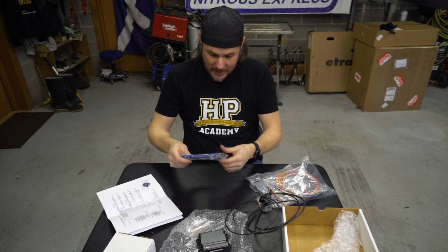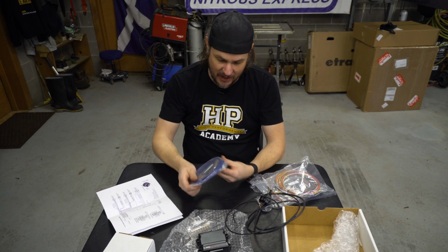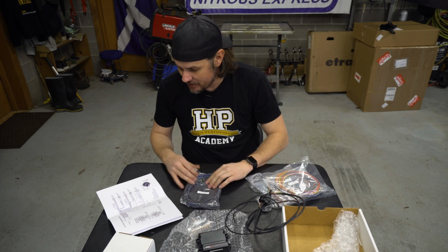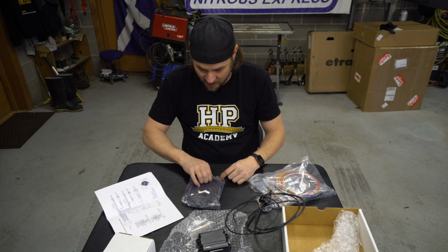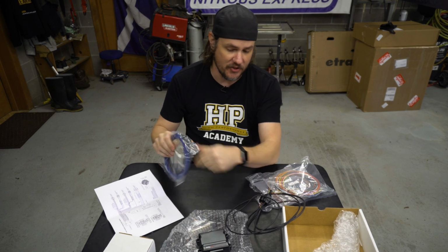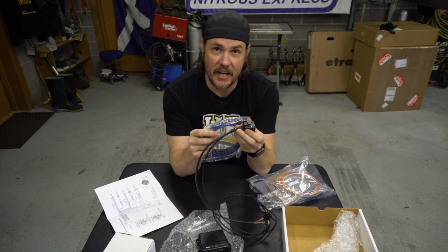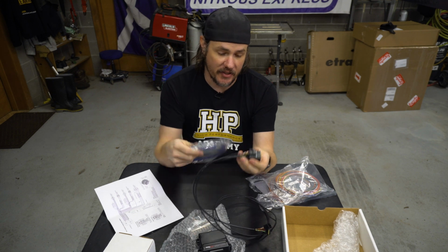So we have a bag labeled sensor, power, and ground. They're black and white striped along with blue. So I'm guessing they're using the blue for the grounds on this one. And in fact, I can see on this diagram that they are. And these are already pre-terminated on one end, and so they're flying leads. You just have to plug those in to the back of your connector where you need to add circuits. And you only add the circuits that you need.